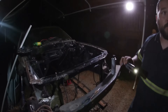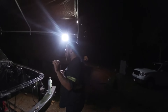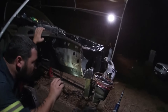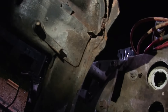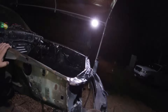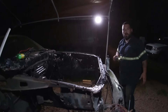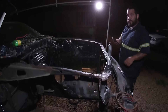Someone came in here and tacked the metal instead of spot welding like it should have been — not ideal, but I'd rather it have been done correctly. There's a little rust spot — no big deal. We're planning on buying the smoothing panels; Scottrod has the panels we're looking at. It's on this side too — just rough up in here, not something you want to find in a project car.